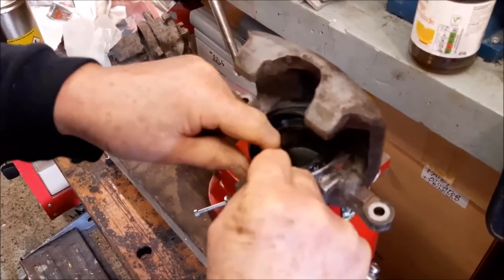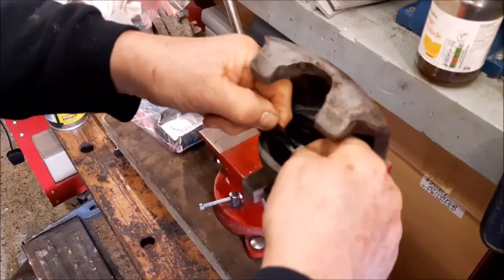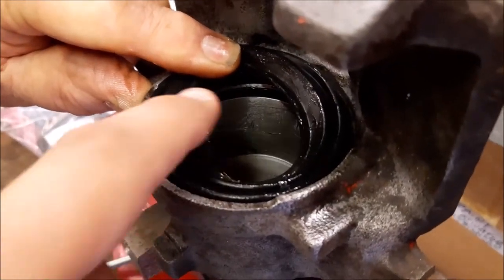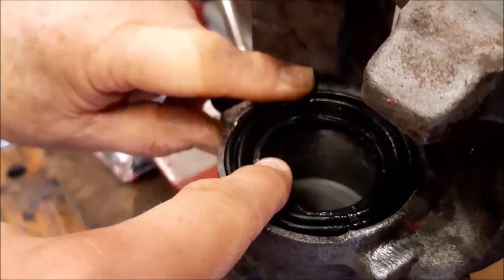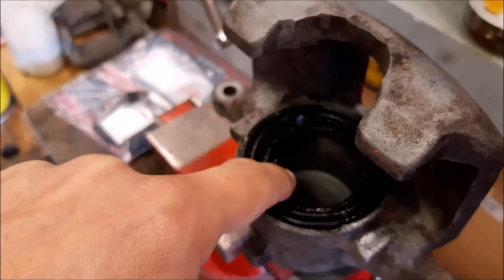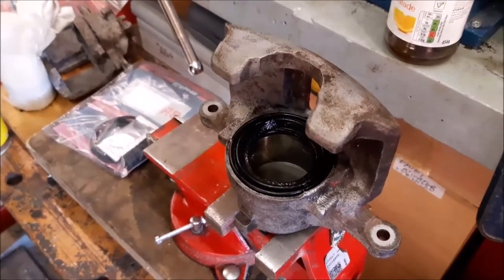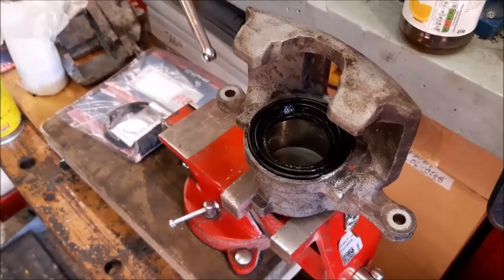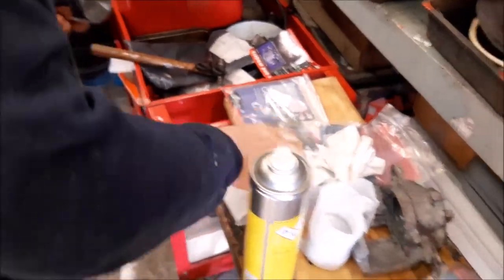All we're doing now is positioning the sealing — you've really got to feel your way around and get that lip in all the way around. We've now got the dust protector seal in. The under flap is now sitting in that seal and the other flap is ready to seal onto the piston when we put it in. We'll push that through and hopefully it'll pop through into that lip. It normally is quite difficult to do — it takes a little bit of fiddling about and patience, and eventually it just goes in and suddenly it's all working. Now putting a little bit of silicone grease on the piston.